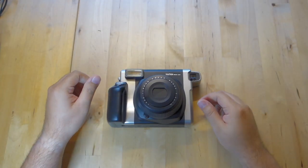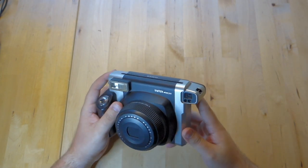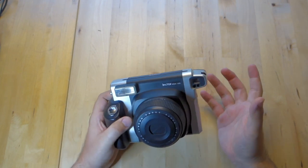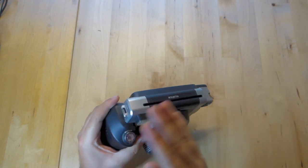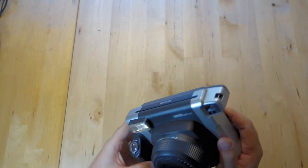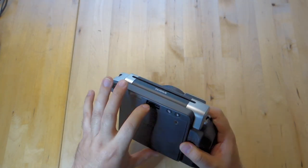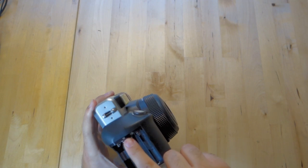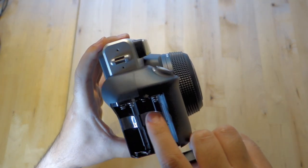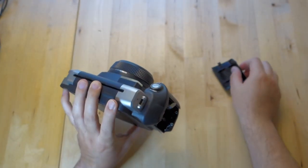There are some things you need to keep track of. The screws are all the same threading. There are a few that are longer than others and I'll try to point out where those go. The rule of thumb is anything that has a rounded head goes on the exterior — it's completely visible at all times. Anything that's a completely flat head is going to be internal or inside the battery compartment. If you open yours up, you can probably see that they're flatter than the rest.